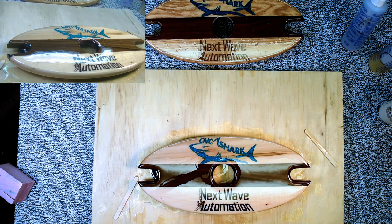And that's it. All we have to do now is let it dry, let it cure, and let it do its thing. Now, if it comes out with a lot of bumpies on it because of dust bits, you can sand it with 400, then 800, then 1,000, and then also polish it at that point. Or if you don't like it that glossy, you can just hit it with Scotch-Brite. It'll dull it down just a little bit to where it has more of a matte finish.